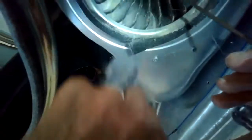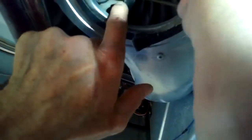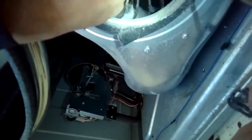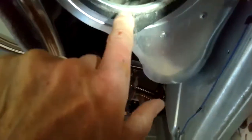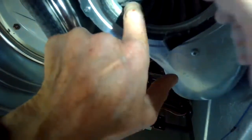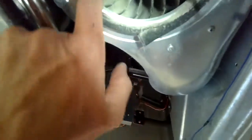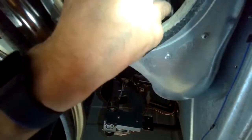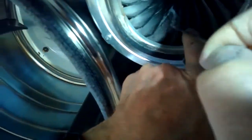I'm using a long flat head screwdriver to help get these big chunks of lint out. This particular homeowner had a long-haired dog, so some of the dog bedding probably gets caught in there too. This problem occurred at about maybe six years of use — it could be just an accumulation of lint. I only see this with Electrolux dryers, and I think it's just the way this blower wheel is designed. The vanes are really long and more apt to catch things, so after a while there's so much accumulation and imbalance it causes that weird rumbling noise.